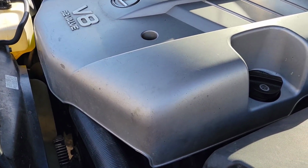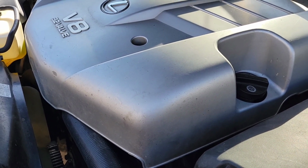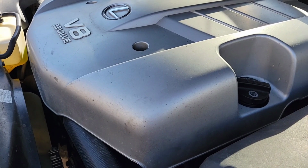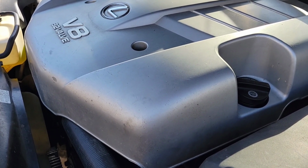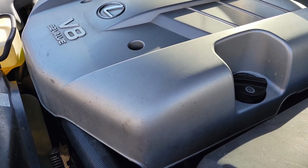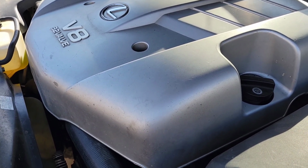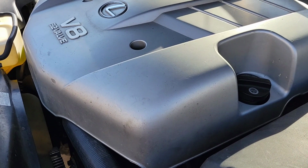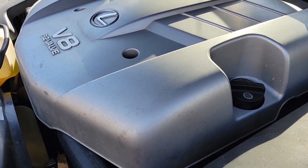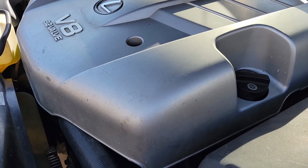Yeah, it's a lot of work, but you're on top and everything kind of comes out more or less. Like I said, removing that coolant pipe on the back is key, I think. So what started out as what I thought was a weak battery, and then I thought was a bad ground, ended up being the starter at the end of the day. But at least I know my battery's good, and I've got some new ground cables in there. So on to the next one.